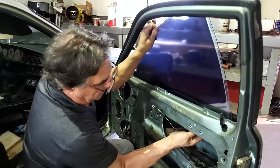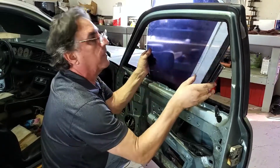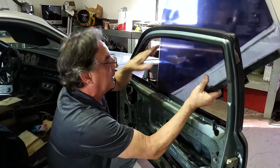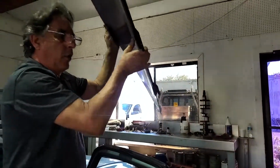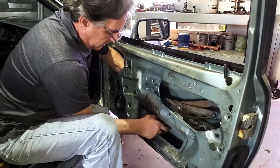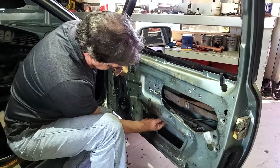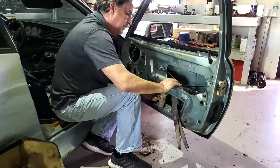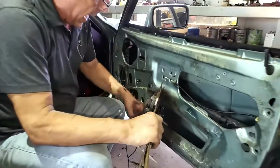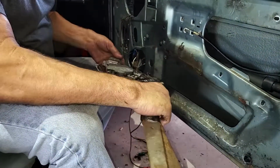And then the glass will come right out of the regulator. And then out. Gently, of course. There we go. They're pretty tough. So we'll go put this someplace safe. Let's remove the regulator itself. I guess we don't need those anymore. Got to be careful not to whack the outside of this. Put a dimple in the door going the other way. That would not be nice.